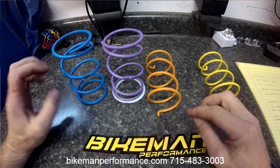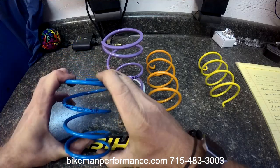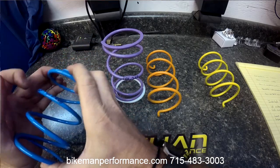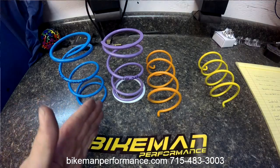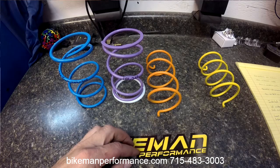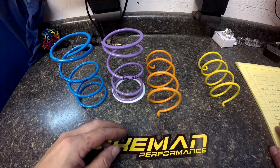Now let's go over what the different numbers mean. All these springs will have a first number and a second number. The first number is installed pressure — so when the spring is installed in the clutch, this one would have 140 pounds; the full shift-out one has 200 pounds. The first number is the low speed, so at lower speeds that first number is more important. The second number applies at higher speeds, so the 260 or the 200 will be your high speed. A lower number equals faster, easier upshift and slower backshift. A higher number equals slower upshift and faster backshift.